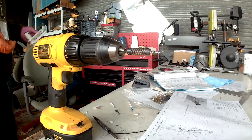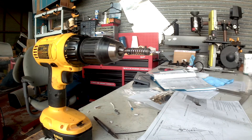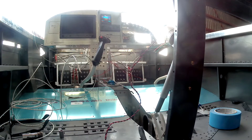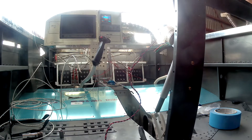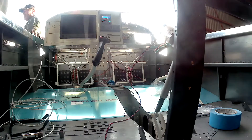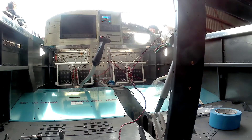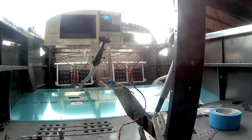Once we drill that, we'll be able to put it in. There are three wires on every potentiometer — two are attached to the strip and one is attached to the wiper. Those are going to plug into the G3X system, and then we'll be able to actually run the flaps via the G3X. In the next video we get that done. You slide it up and down to make sure it doesn't get in the way of anything.